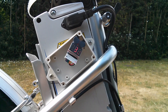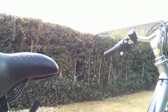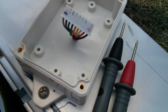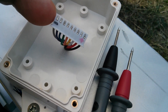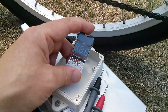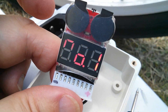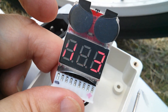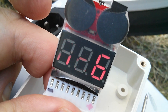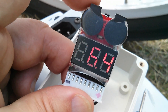So now I've got this variation in the voltages. I've measured all the cell voltages by putting the DVM across these test points in pairs, and they're all within about 10 millivolts of each other. So it would seem that the problem is this little cheap monitoring unit — it just isn't very accurate. It measures the cells as being all quite different, 332, 333, but they're actually not. They're all within about 10 millivolts of each other. So I'm not too worried.